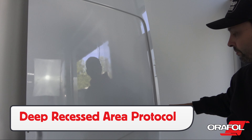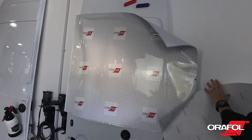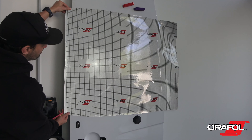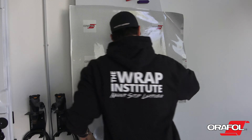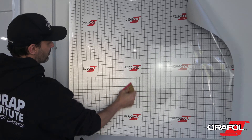Using a pod steamer is a great tip as it can warm the film softly, yet thoroughly, to form it on. Be sure to use the tuck and cut method for raised objects like the molding at the bottom of the bumper. Tucking the film in, then sealing the deal, ensures long-term durability.